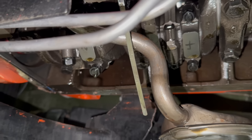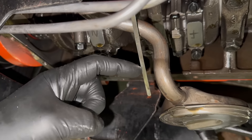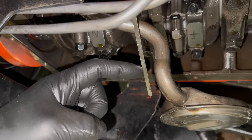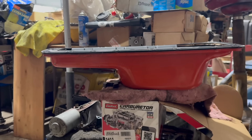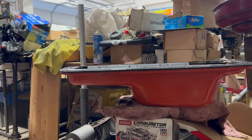Not to the point that I'm worried about it, but to the point that we need to figure out what's wrong here. This engine was rebuilt by a gentleman who's no longer with us, and it really had no miles on it before it got here. We checked the oil — we're not complete idiots — and it was low, about a quart, quart and a half. But that is a seven-quart oil pan, used on six-packs and late HP motors. Hemis got a similar deep pan as well. We wanted to get in here anyway because there was no windage tray — we're going to install one of these fancy Moroso windage tray seal assemblies.